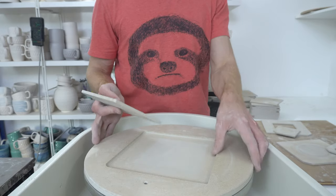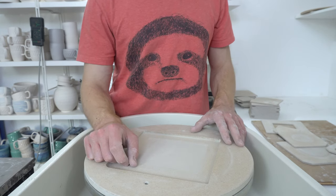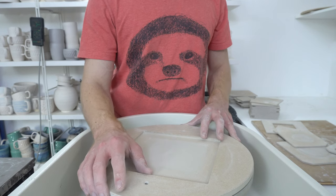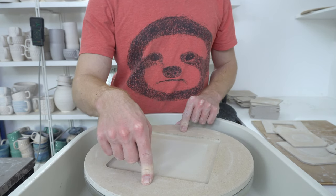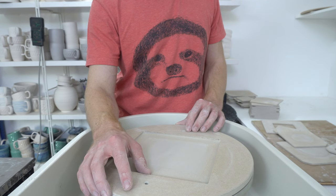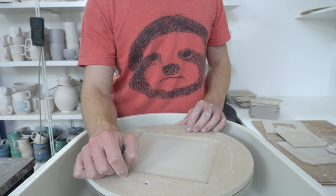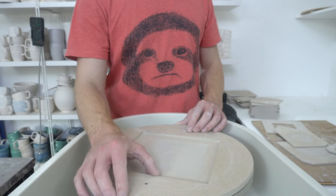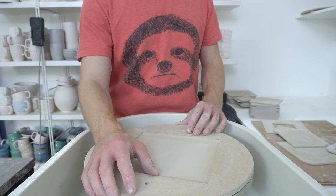Other than that, they just literally fit on and work. The nice thing with Hartley & Noble is they're a small British company and because they're small they can personalise any part of it. These are all CNC milled, so you can specify exactly what size holes you want and how far apart you want them — so if you've got a weird wheel size they can accommodate that. I got these done slightly non-standard because I measured the back pins for the Scut at 9.6mm rather than 10mm, so I got them to make the holes just a fraction smaller for a tighter fit.